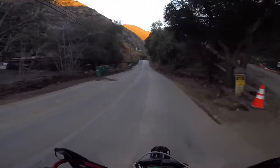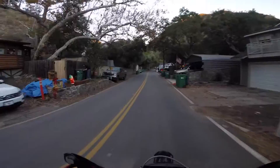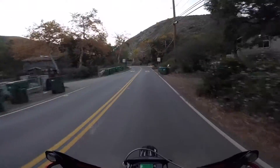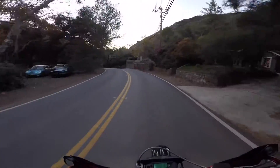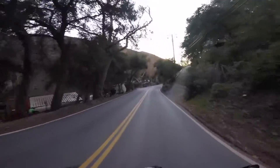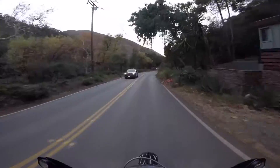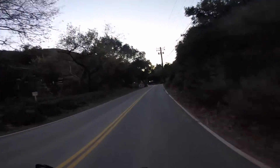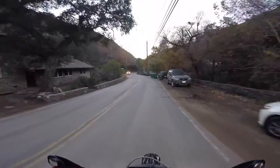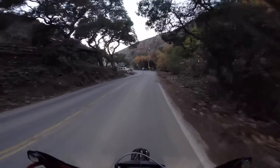Perhaps we'll have to duck into virtual reality in a bit so I can demonstrate. Isn't this a nice, beautiful little Christmas town? The tires and clutch are good. I also cleaned my front brake caliper — scrubbed the pistons and got a bunch of dirt and crud that had built up over time off of there. My pistons move a lot better now, so the front brake has probably two to three times the stopping power it did before, between the new sticky front tire and the better-moving brake pistons. I'm quite happy with things so far, and very much looking forward to getting this bike out to a kart track.